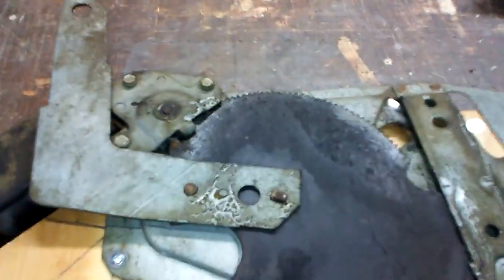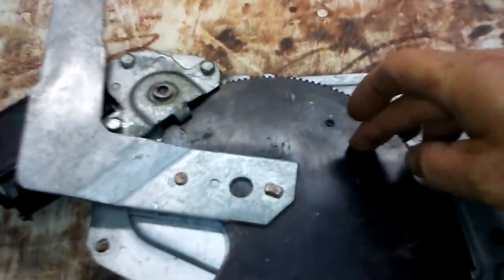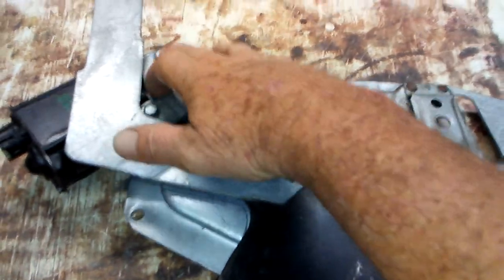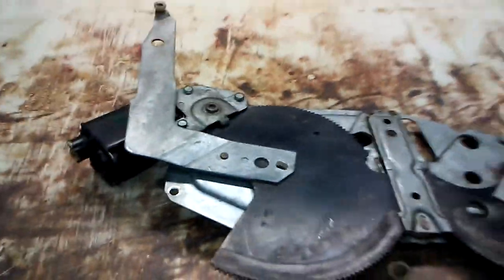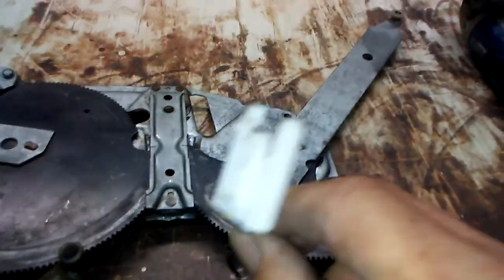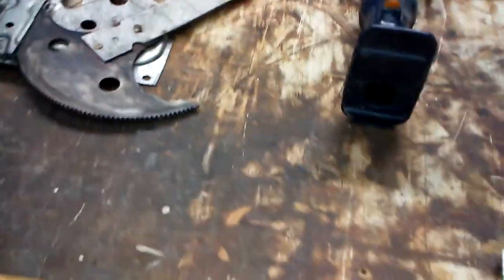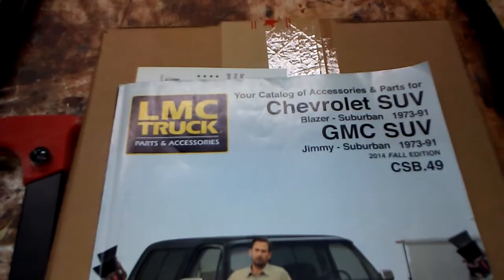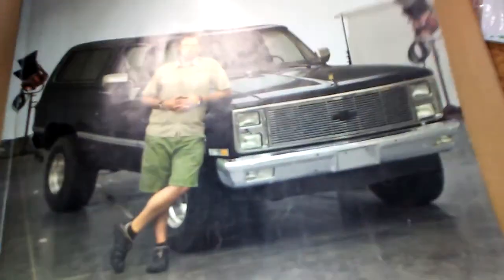You don't want to take the motor out until you lock the gear in — drill it out, put a bolt in, lock it tight — and then you can remove the motor and put your new one in. It should come with a new pigtail. LMC Magazine has a lot of the parts for the Suburbans and Blazers.